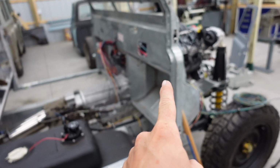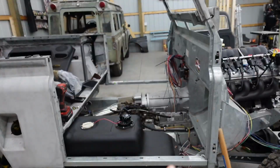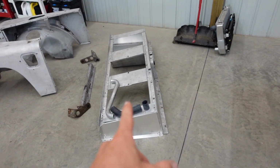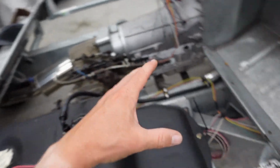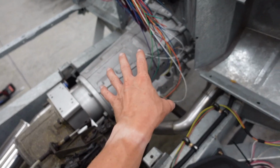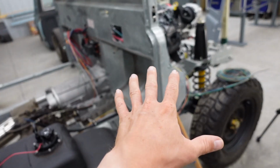And once the bulkhead is exactly where we need it, the doors will fit nicely. Everything will be square and correct distance. We can bolt the seat box back into place. Then we can make up our new floors and finalize our transmission tunnel with everything at the correct distance. Because if our bulkhead was 1/4 inch off, our floors would be 1/4 inch off.